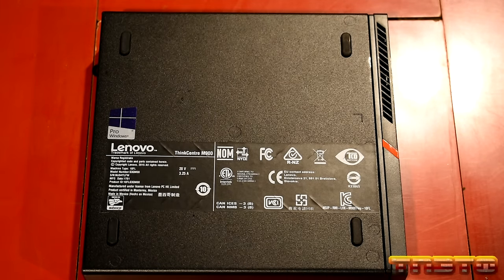USB key, M.2 SATA. I'm not too concerned about that. We'll do X. So that gets rid of that. The SATA drive, we don't have a SATA drive in there. Network. USB hard drive, USB CD-ROM, other device. So by default, it's going to try to boot from the NVMe drive. Second, it's going to try to boot from a USB hard drive. And then I think that's a floppy disk drive. So we'll keep it like that. Okay, escape.